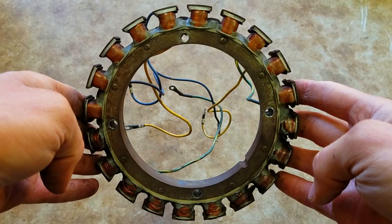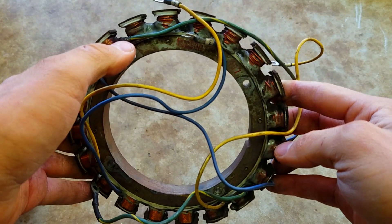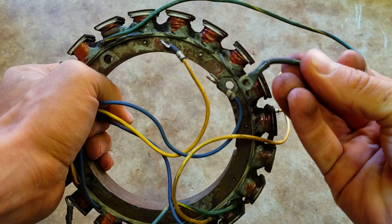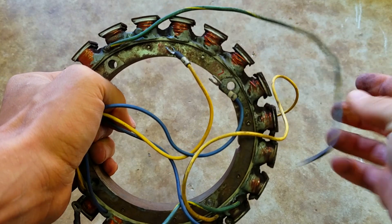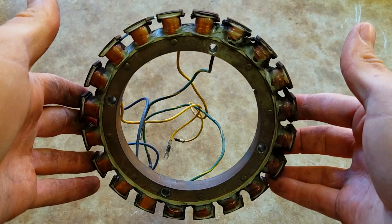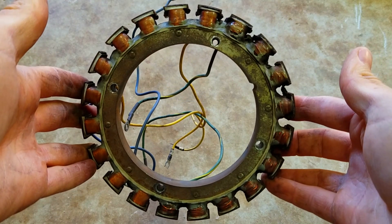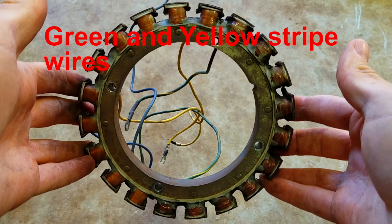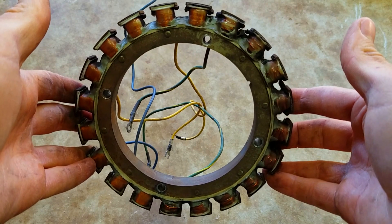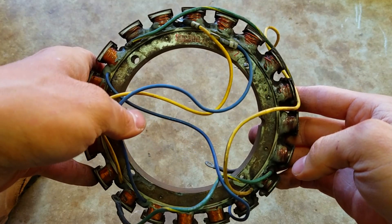You can test these things with a multimeter real quick and easy to see if it's failed. You're going to have to check online to see what wires go where. On this stator, the green and yellow wires are the wires that go to the rectifier — I know that because they have the ring terminals on them. It's not always like that for all outboards, but on this one it is. All stators generate AC voltage, and on any outboard that AC voltage has to be converted to DC voltage in order to charge your battery. These yellow wires send out AC voltage to a rectifier, which then converts the AC to DC to charge your battery.